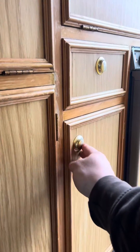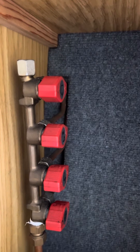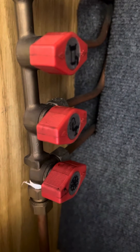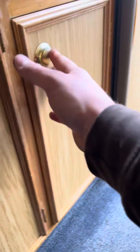The cupboard to the right of this one — you'll see there: gas tap status. You've got all of your gas isolators down here. At the top there you've got the two burner and grill, heater, water heater, and fridge. So if you wanted to isolate the gas from any of those appliances specifically and individually, you can do it from there.